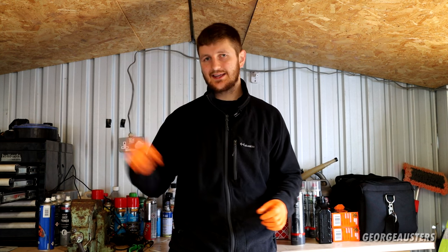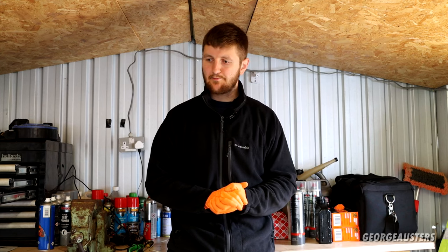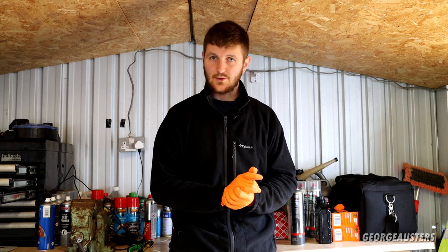So the next best thing, if you don't want to go through all that trouble, is literally just to remove one of the washer hoses and then blow some compressed air through — that should all come out of the reservoir. Just keep doing that, filling it up with fresh water and blowing the air through, and hopefully you should get rid of all that junk in there. Once you know that you have fluid at a good rate to the washer jets themselves, if it's still not coming through the washer jets, disassemble them, remove them, clean them out, and then hopefully you should have a nice steady stream of washer fluid onto your windscreen.